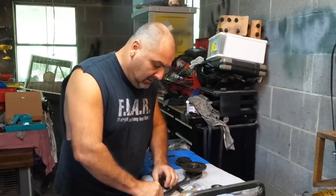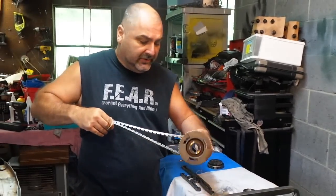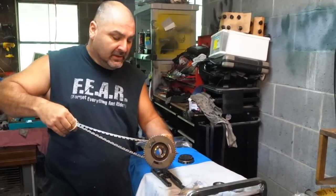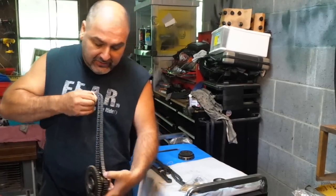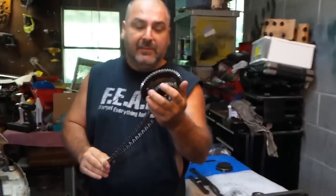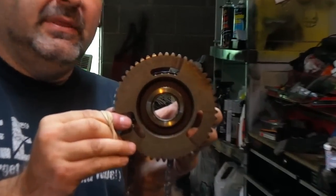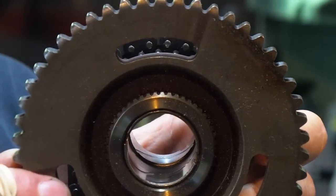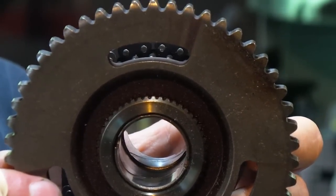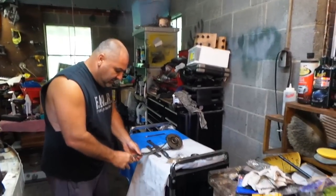Here's our trick on how to put this together. Take your first chain - we know the 12 o'clock position - so we start on the passenger side because that's the back one, the one that goes on the back fully. We just got it in hand and we're going to lay it up here. We're going to be able to see through this window - right there, you can see the two black links. We slide that on there, make sure we can see it through the window. To keep this from being a pain, we're going to take some rubber bands to hold the chain in place.